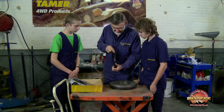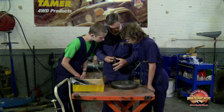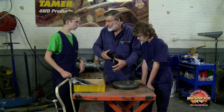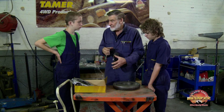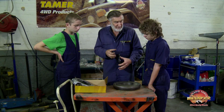See that? There's a spring in between there — a wavy spring. See how I can push them together like that? That means as you're letting your foot off the clutch, it just starts to touch for a minute. It starts to take up smoothly, more and more pressure, and it gets solid. If that was solid it would just go bang — in or out. But it's got those cushion springs. So if a clutch becomes sort of sudden and jerky, sometimes those cushion springs are weak.